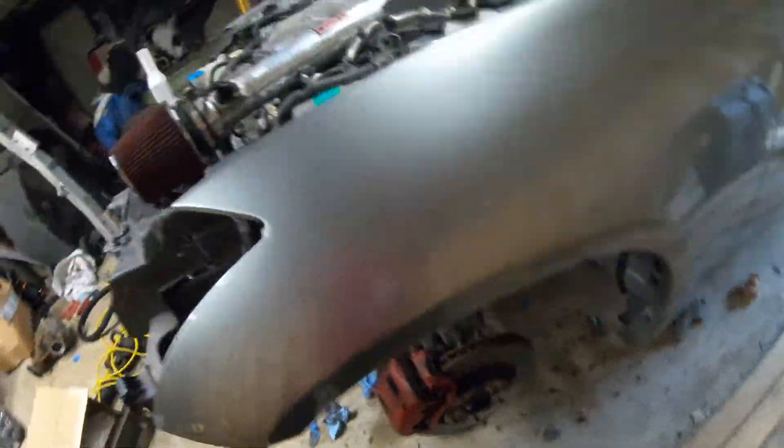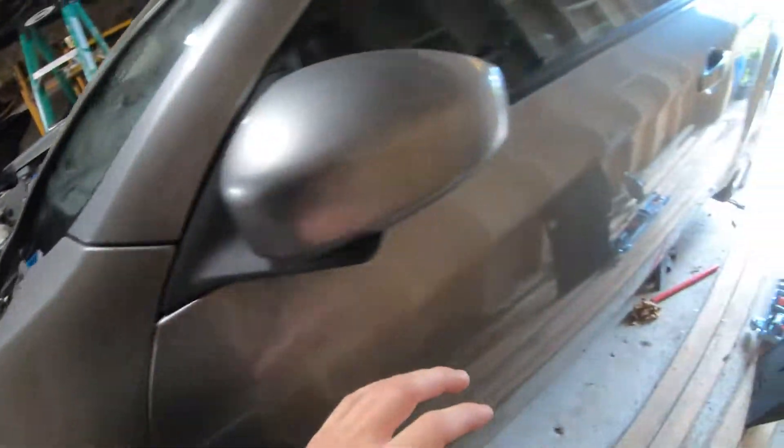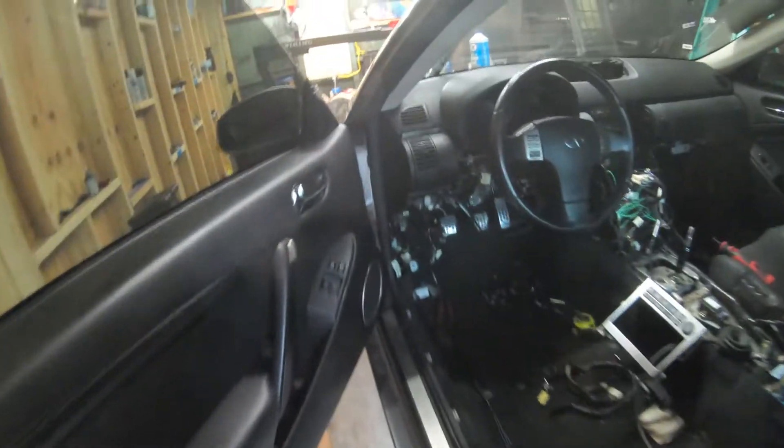The brake pads look okay I think. I'm going to work on getting the car completely back together and probably throw the hood on soon - just finishing up stuff really, which is crazy to say because I didn't even think the car was going to run today. I'm having a lot of trouble bleeding the clutch right now - apparently I'm supposed to gravity bleed it for a bit. There's no resistance at all and the clutch doesn't come back. Hopefully this works because after this I can move on to actual stuff - you kinda need your clutch. After this we can see if the wheels spin.